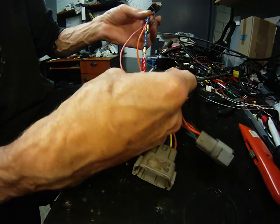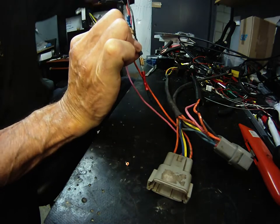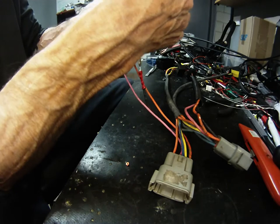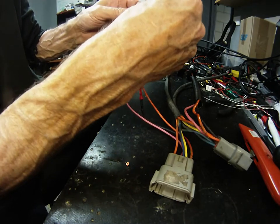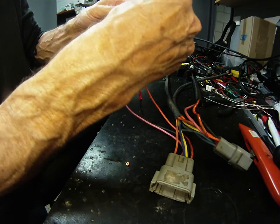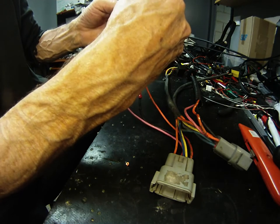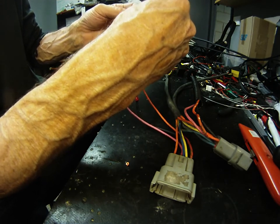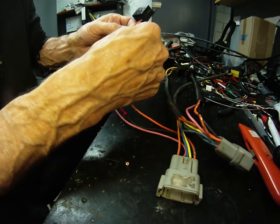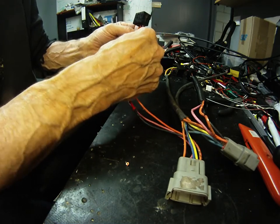The centre point of those resistors will be half the voltage — 12 on one side, 0 on the other — so that is 6 volts out to this wire. At the end we get 12 volts at the orange, 6 volts at the black. So when the switch closes between the black and the pink, it sends 6 volts to the computer — track goes forwards. When it switches the other way, orange to pink — the track goes backwards. Orange to pink: track backwards. Pink to black: track forwards.